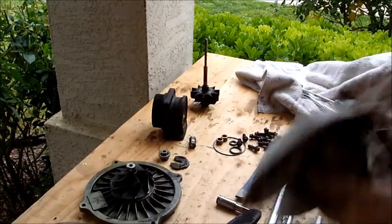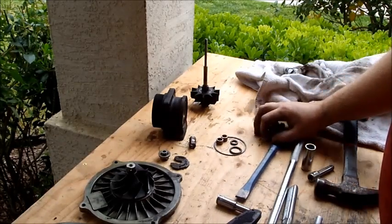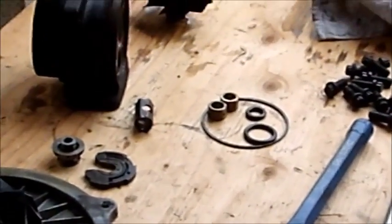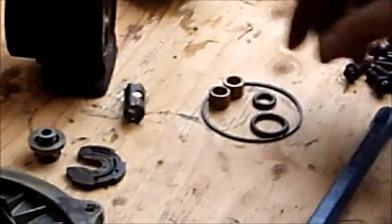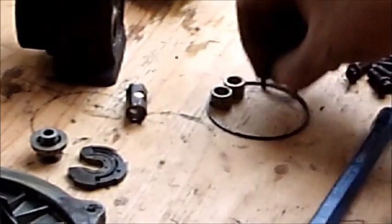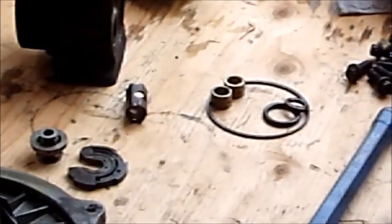The last thing you're left with is inside that carrier. It's going to spit out a few things — these two o-rings mate to the pedestal. Mine look like they're in good shape, however I'm going to go ahead and replace those. I wasn't sure if my rebuild kit came with them, but it did — it came with both. So that 360 rebuild kit is complete. It comes with the pedestal seals and everything. That's a great kit.